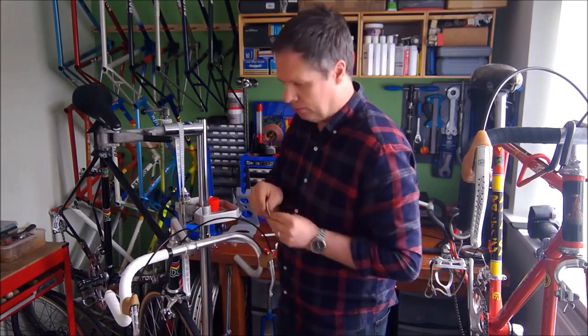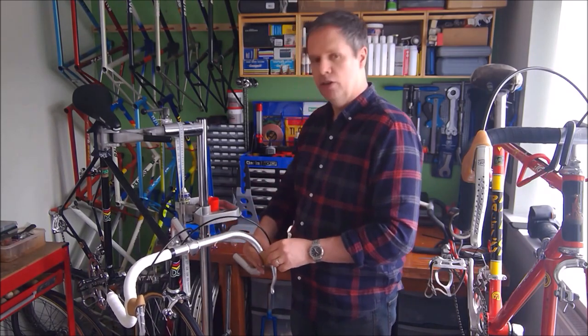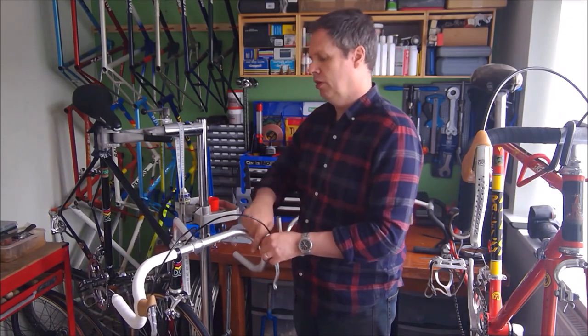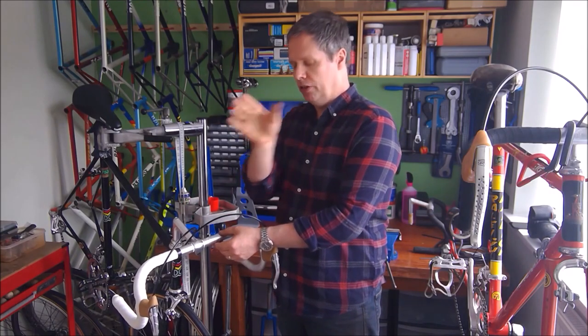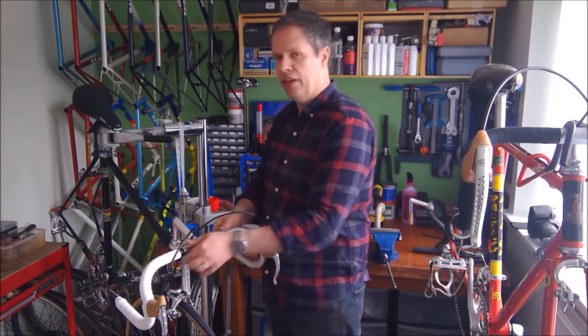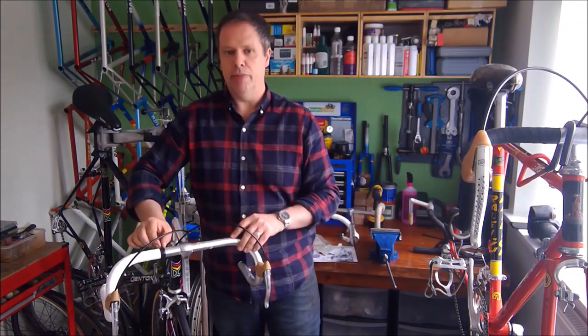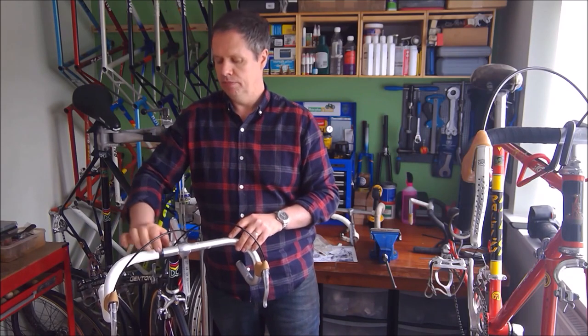But now I move on to the second side, exactly the same. Start from the bottom, wrap it over, do a little loop around the brake lever, continue, and you should come naturally up to following there around. The finishing tape you've got prepared, two lengths, cut one thickness into a third and two-thirds ratio. Use the thinner one to actually secure the tape in place, and then the slightly thicker one to give you your finishing effect, which means that you have a thin band of tape rather than the normal inch and a half that most people just wrap around.